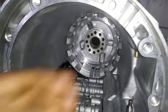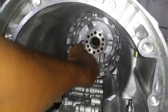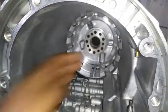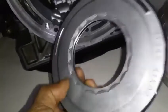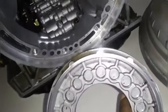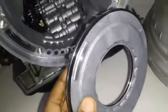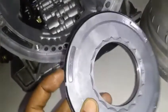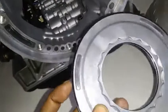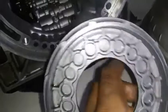Pass your fingers on the inside surface of where the seal is applying itself, and on the outside, to make sure it's absolutely smooth. Once the oil seal and the D-ring have been replaced on this low and reverse brake piston, it will most likely not look the same as the one that was removed. To help it look the same, you will want to use masking tape to tape the end of the seal in, holding it to conform to a position similar to the one that was removed, so it can fit perfectly into its cylinder when the tape is removed.